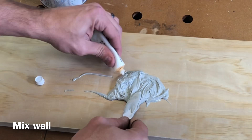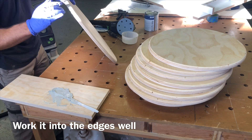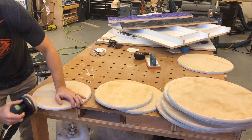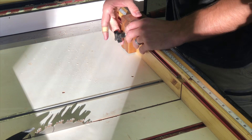You've got to work pretty quick — mix the right amount and you only have a couple of minutes to work. The stuff's pretty cheap, so if it hardens up, just mix up a new batch. I started applying it with a Bondo trowel, then ended up just using nitrile gloves and wiping it in with my hands because it seemed to get into those cracks a little bit better. The Bondo is ready to sand in just a couple of hours and sands really nice. It is going to be a paint finish so it doesn't have to be perfect, but just get it nice and smooth.